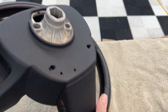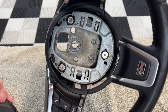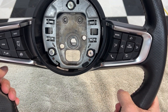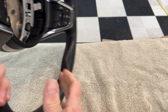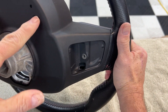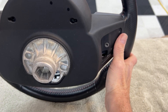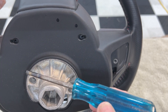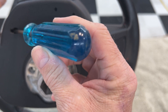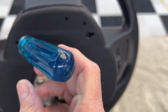To get to these while the wheel is in the car, you want to turn it 180 degrees, and then you can start working on it. The reason why is because now these are above the area. You're going to reach around to the back of the steering wheel and kind of slide the tool in at an angle until it kind of stops, then feel it and pull.